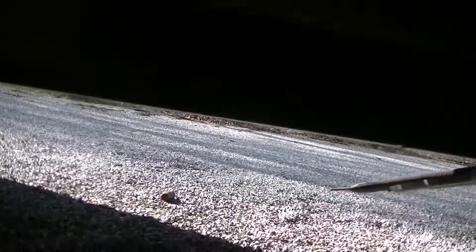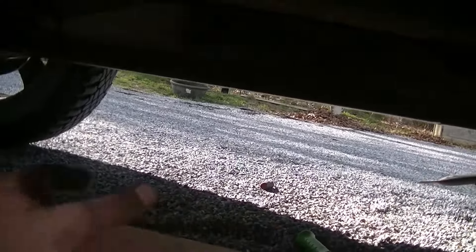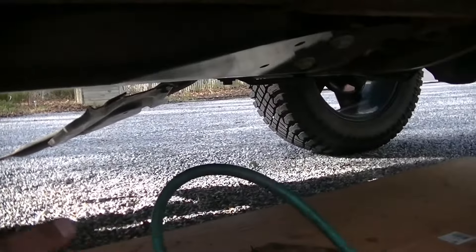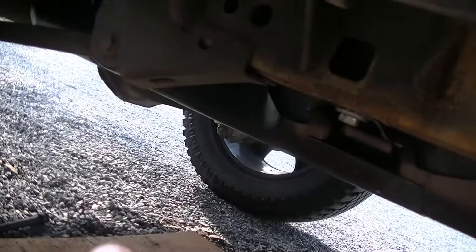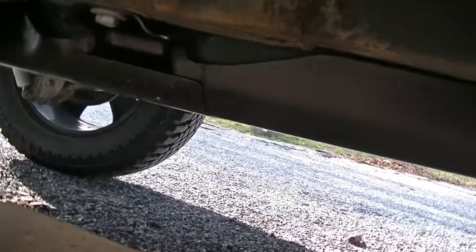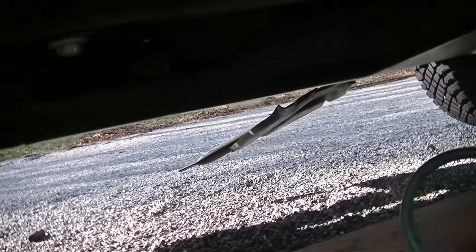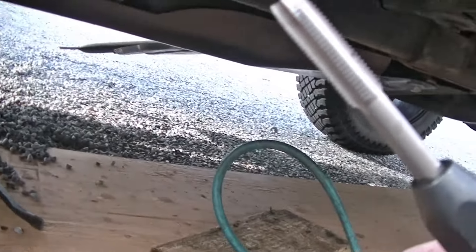We got our skid back up here. The easiest way to do this is to set your jack up long ways so you can roll it back and forth. What you have to do is get it under the car, slide it forward about four or five inches, and jack it up so that you clear the rear axle. Once you clear that, roll it back into place and jack it up the rest of the way. I'm making my final torquing of all of these bolts here, and I do have one that I need to clean up with a tap — it is a 12 millimeter by 1.5.